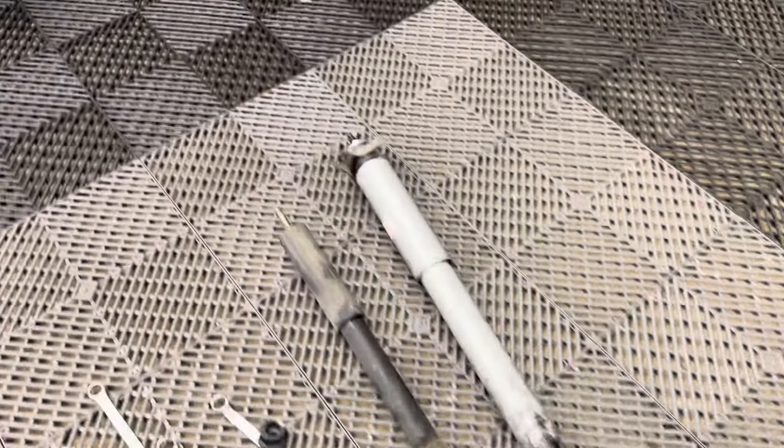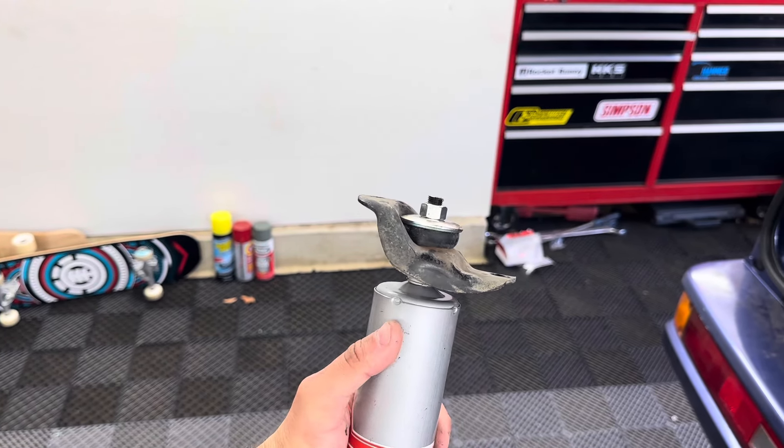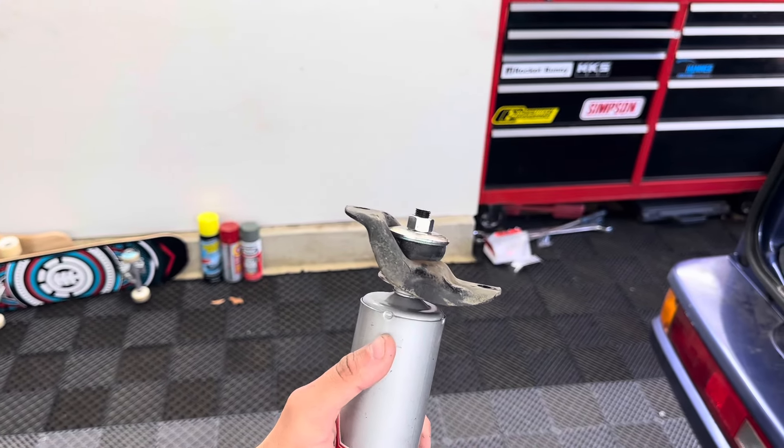I'm going to cut this one real quick. I did prep this one and put the shock isolator in the top, so I did need to cut the top of the stem — the strut stem — because it was hitting the underside of the van when I tried to bolt it up. I've only had to do that on some of them. The other thing you could do is stack washers or bushings underneath, but the problem with stacking washers is the more you push the strut down, the more you're going to lift the Acty. These struts are always under load on this vehicle. Some people use these when they lift their vehicle to get an extra quarter to half inch. This is really good if you're putting more weight in the back. Some people do say it raises the back a little bit, but the ride quality is so much better.